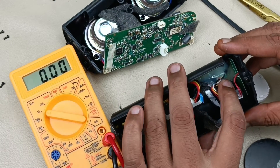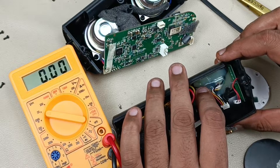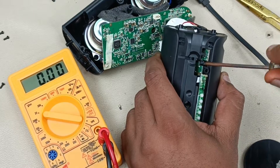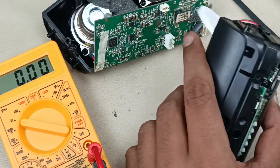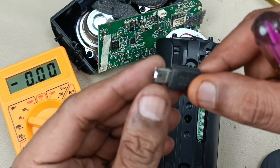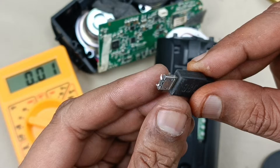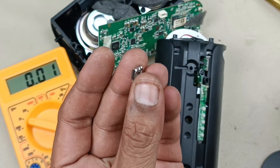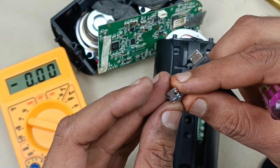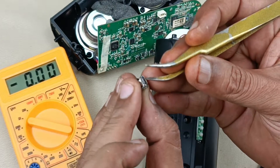Now to access this charging board we have to remove this glue — it is very easy to remove, I will explain. First let me remove this screw here. The socket itself has come out — okay, this is broken. You can see it is fixed in the cable itself; it might be dry soldered. I am just removing the pin here. The pin is good but the solder is removed.